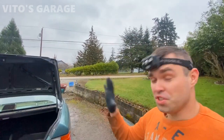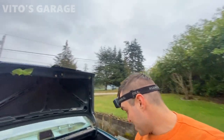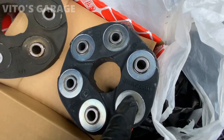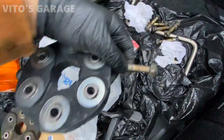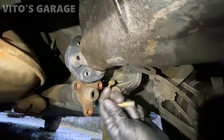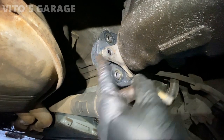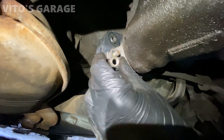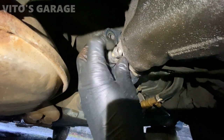We've got a couple more things left to do on this car, and this car has been amazing. Hopefully we find an amazing good home for this machine. Just a quick comparison — made in Germany — this is the original Mercedes-Benz. Installing this new one, and I'm gonna use the same hardware. I also put copper paste on all six points of both yokes and installed the flex disc. The side with no yoke gets a washer; the nut on the other side is without the washer. The previous installer didn't put it the right way.